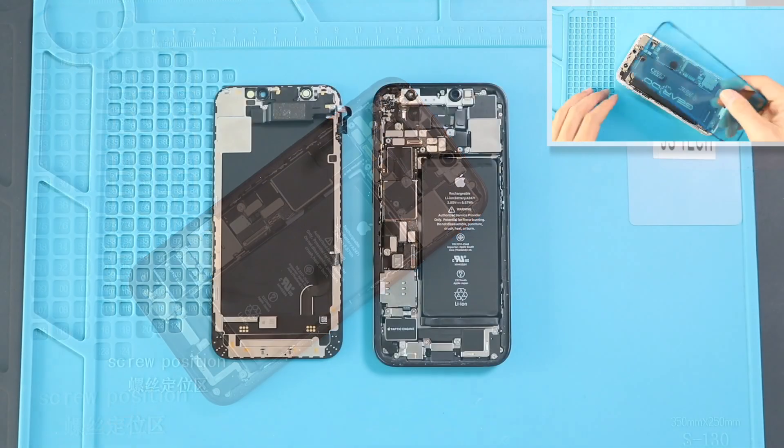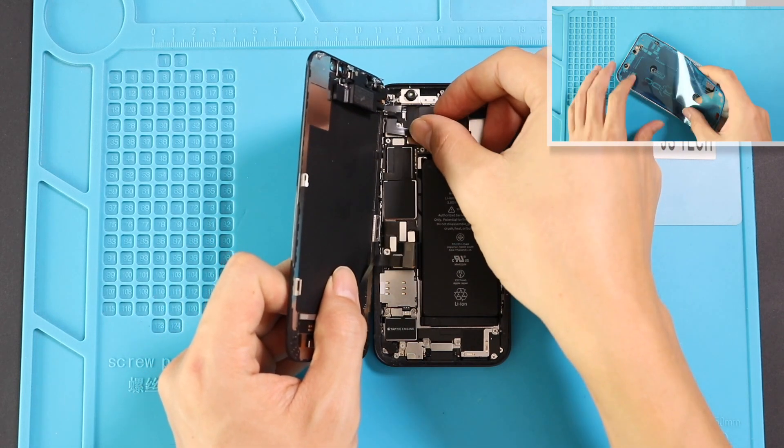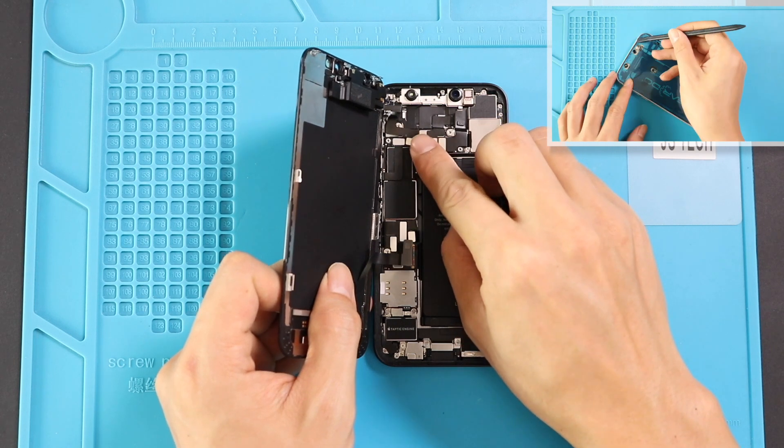Next, it is good to place the frame adhesive into the frame. Then place the front screen on the body. First, connect the earpiece assembly, LCD connector, and battery plugs to the board. Also, make sure to place both shields by adding two screws.